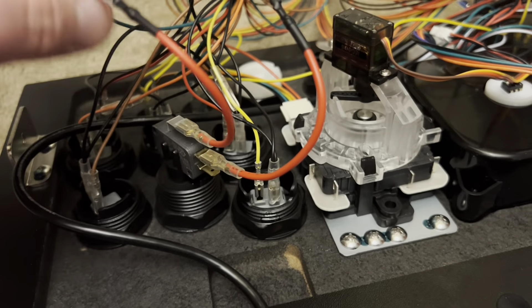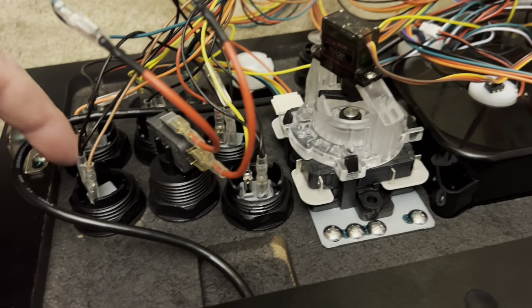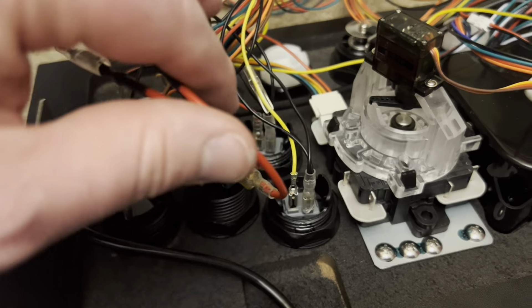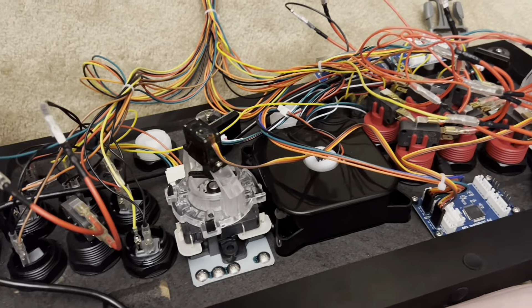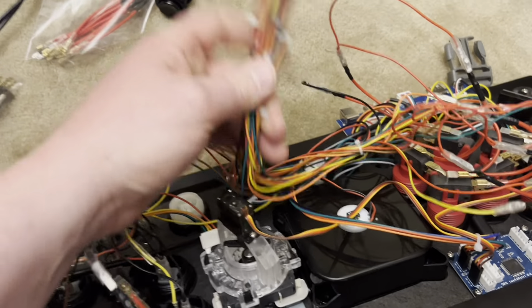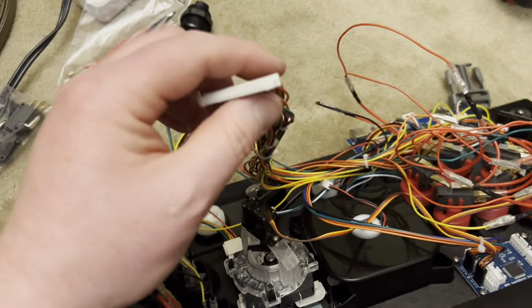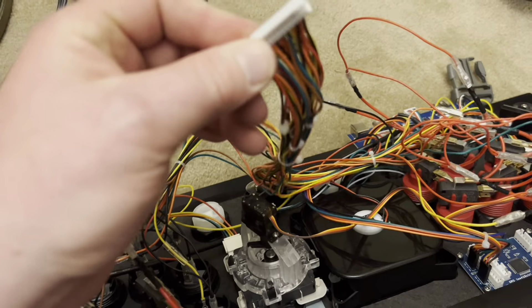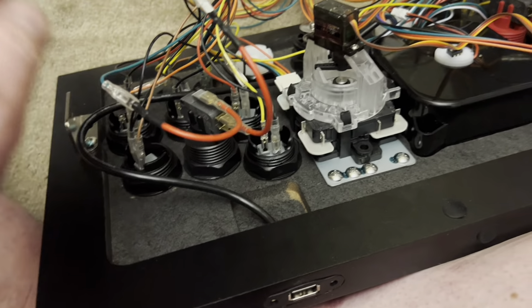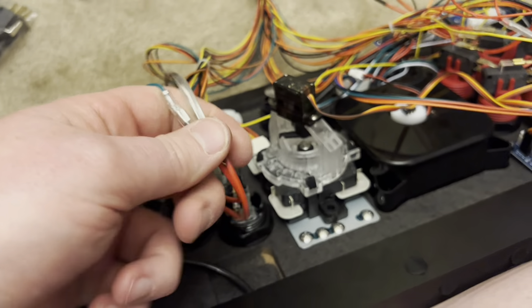Here you'll see I got those adapters connected to the original wires. And you saw how I did that button — now I've got to do that for five more buttons to finish player two. In the end, I should have both players now working. And that's it. Now you should know how to disconnect and connect this — that was part of putting the deck in the first place. But if you don't know, I will show you when I connect this back up when I'm done. Just do one button at a time, get all of them done — as long as you're doing one at a time, you know you're using the right wires.